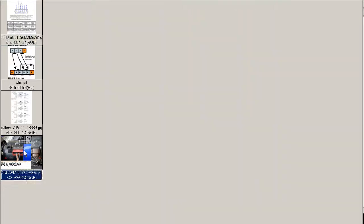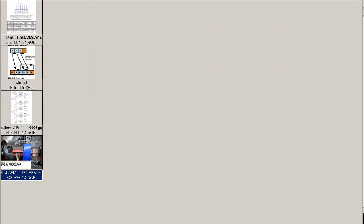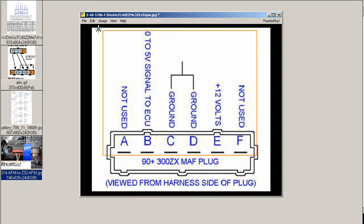This is only an example — it notes S14 on here, but there are two kinds of S14 wiring, so you need to establish which is yours. In this example, the white wire simply went to the white wire, black wire to black wire, black and white wire to black and white wire. But it's not always that simple. The orange is often the earth or ground or chassis, but not on every occasion, so just be careful. The important thing is that you follow this diagram and make sure that the wires match your vehicle.